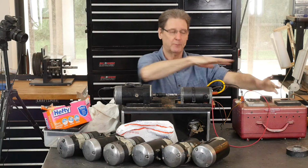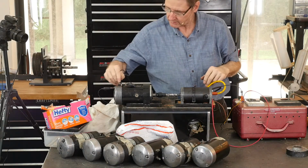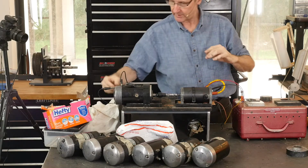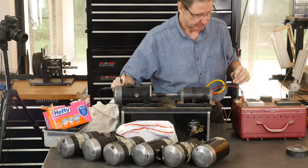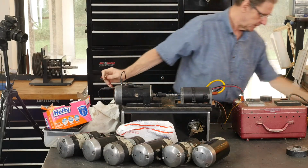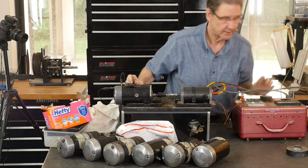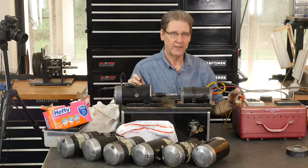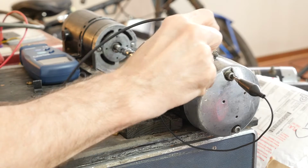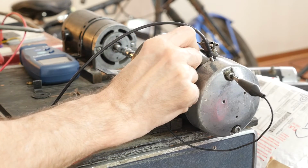We've got this power supply. It's off now. Let's get the negative. Will it go in here? I guess it'll fit there. Get the positive. Remember, this could be lethal voltages, so be careful. Shouldn't get up too high. This motor's 100 and some, and you got to buzz it. Let me go turn this guy on. Hear the little fan going. Connect to the armature. Field's grounded. The one side of the power supply ground is to the metal frame. The other side's here.